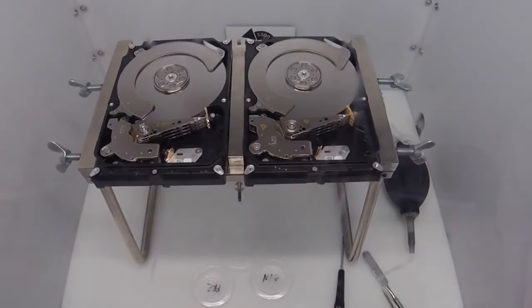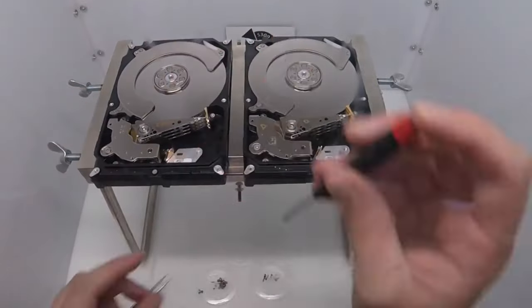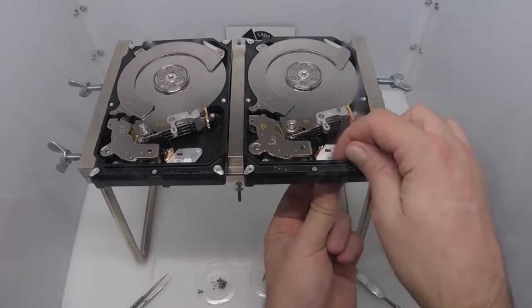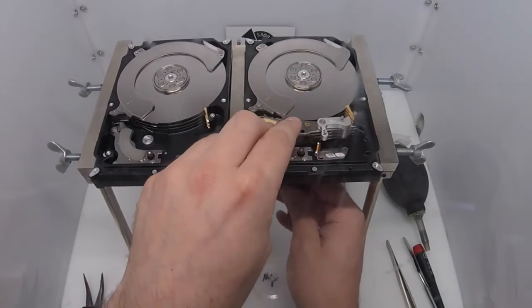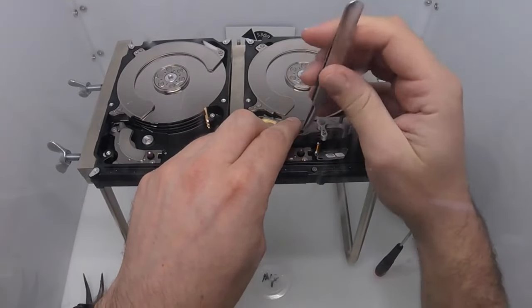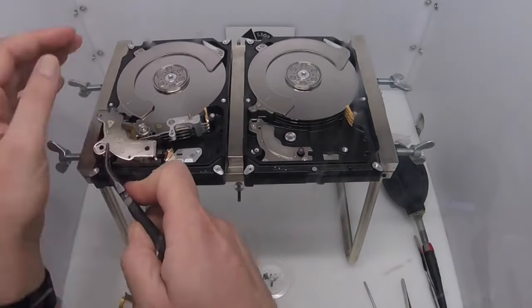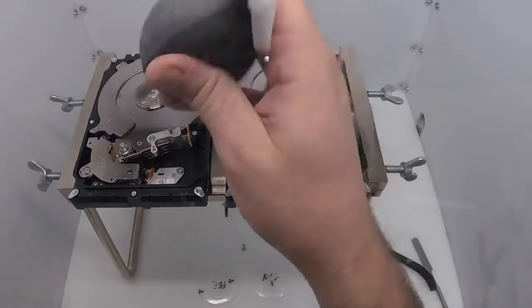You can't just go buy another new three-terabyte Seagate drive because the issue has been resolved and the current production is different. The specs you have to match when finding compatible heads require a lot of research. Even if you match the labels on the hard drives — identical except for the serial number, same factory, same date — the heads the drives use could still be different. That's why we've looked into head swaps but found there are just too many variables.